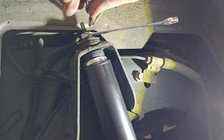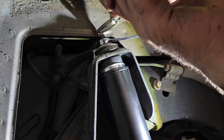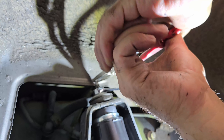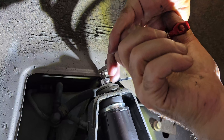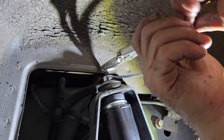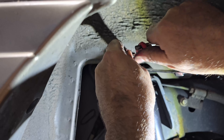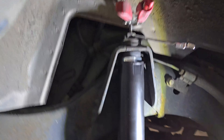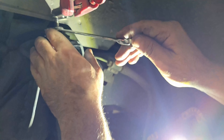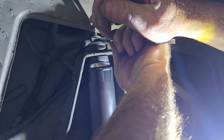We're using a thinner wrench — it doesn't ratchet. We're going to get our locking pliers onto that top stud. This locking pliers has a little part on the end where you can actually place an object through it and tighten it more instead of using just the little wheel-type hole. We'll tighten it down and get some final tightening on it.